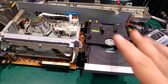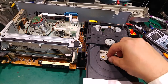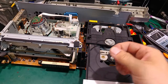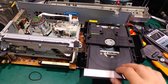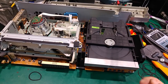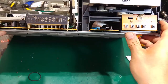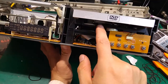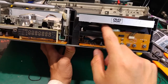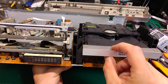I just picked this up to basically remind me of when I was using them. Let's get to the problem — there is a very common problem: we've got a very loose belt on this tray and we are going to replace that. When I got this unit it was completely locked and I was unable to open it. What you would like to do is find the gear that is rotating by the pulley and just use your finger to rotate and eject it that way.